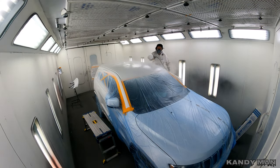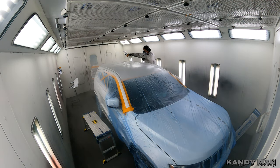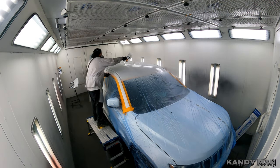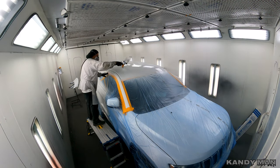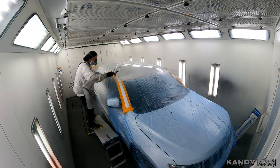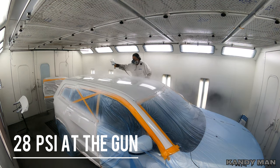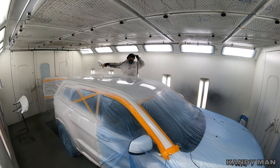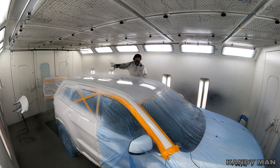You've seen the thumbnail — I'm using that Techniclear coat gun, the gold one, and that's got the 1.3 tip with the TE25 air cap. That's my go-to gun for bigger jobs like this, especially a roof, because you can move through the job real quick — a lot quicker than the DV-1. I like my DV-1 for certain jobs, but I also like having other guns when I want to move through something faster. White especially, because you don't have to worry about overlapping as much — this thing hoses it on real fast and nice. We put two coats of CC200 on this one, went one step slower on the reducer so it laid out nice on the roof. I used the US-5 with the UH-90 hardener and put it on nice and wet so it flowed out nicely on that roof.